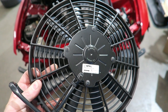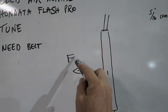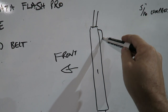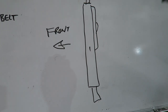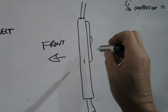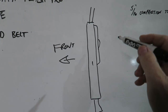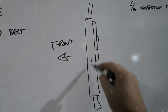So there's two ways you can do it. Let's say this is the front of the car — that's the way the car would go as you drive down the road, the air goes this way. A pull fan would mean it sits behind the radiator and pulls air this way. Don't quote me on the percentage, but this is the more efficient way — a pull fan is always stronger than a push fan. I think it's due to atmospheric pressure, but the same CFM fan as a pull will be more effective than a push.